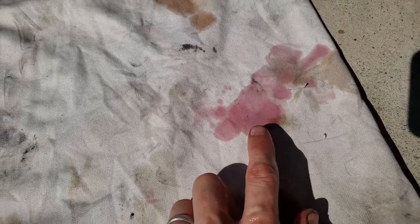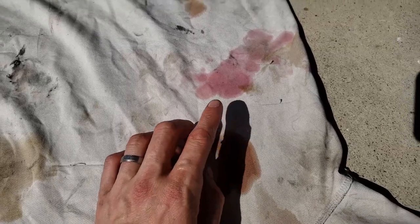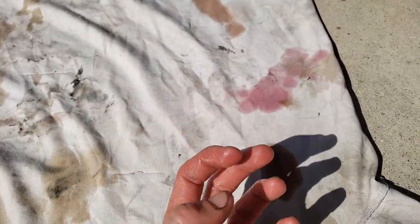Here's our old fluid — you can see it's kind of dark red, light brown, which means it's due a change. Here's the fresh stuff, which is clearly red-pink. With transmission fluid it's really important that the fluid gets changed because it degrades over time. It's not like an engine where you can leave the oil for a while and it still chugs over. Transmission fluid is really important — as it goes old it goes more brown, and to cool down the transmission when the gears are changing, it's really important that the transmission fluid does its job.